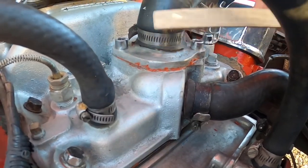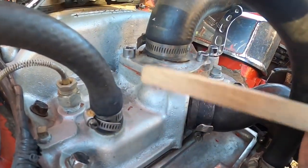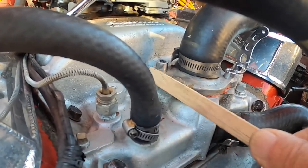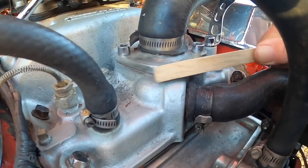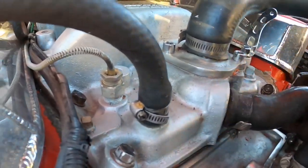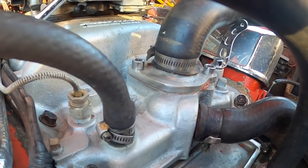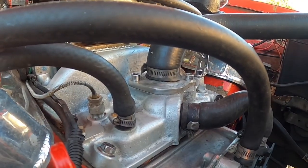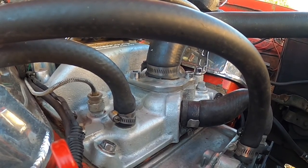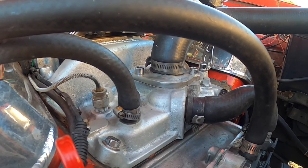After I do that, I go along it with a bronze wire brush and just brush the seam real good — you can see how that works. You just keep going like that and it's all nice and clean. And there we go — proof that you don't need a gasket and that RTV will seal even when wet. This engine's been run two or three times up to the temperature that the fans come on, which is 210°F, so I know there are no leaks and it's all set to go.